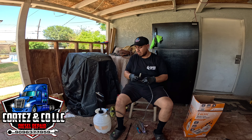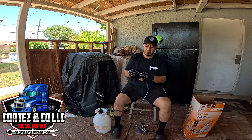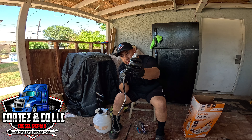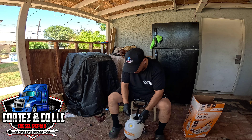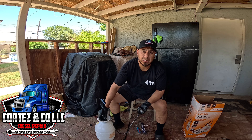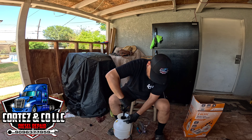Wait a minute, doing this wrong. I need another adapter — I'm going to have to go back to Home Depot and get another adapter. Regardless, this is how I'm going to make it. Real simple guys, cost me under $50. The actual pump is about $350 to $400. I did look for it this past week after I knew about these trucks. There is a way you could prime it on the actual fuel filter module, but you have to prime it like 150-plus times and it gets tiring. So I decided to do this.